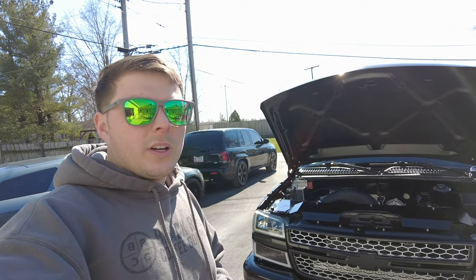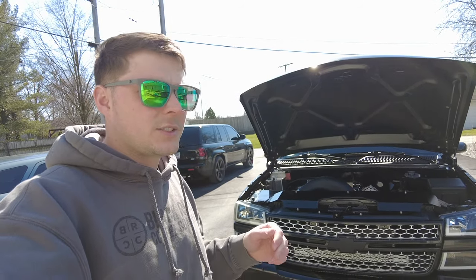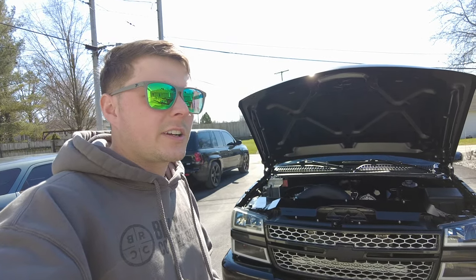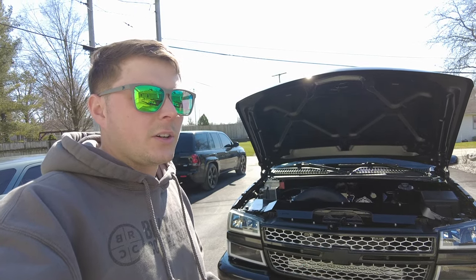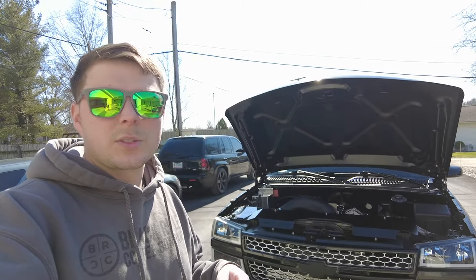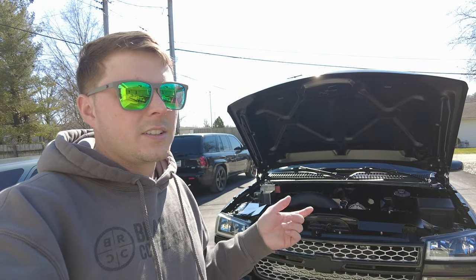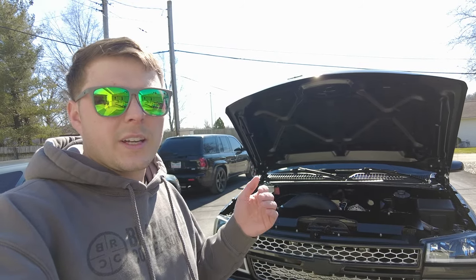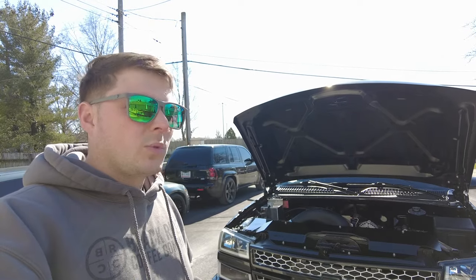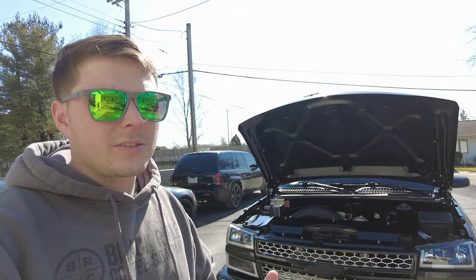But performance-wise, Sean Fensler, Bumper Wilson Tuning, does all my tuning for me. Great dude. He has some high horsepower cars there. So before, on the old 4.8 with a 4L60E, medium cam with a 2800 stall, the truck made like 355 on a hub dyno. So not too bad for a little 4.8, but it was gutted. That thing was not that fast. It was super slow. So we swapped to the 6.0, and we've done a bunch of other stuff like e-fans, 10% underdrive pulley, different alternator pulley. We went to a larger cam, like a 236 by 242 with a 112 LSA. Went to the Frankenstein heads, did a bunch of stuff, went to a 3800 to 3900 stall. So we definitely bumped up the numbers here.